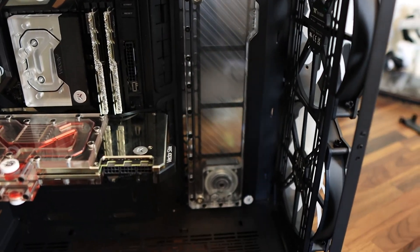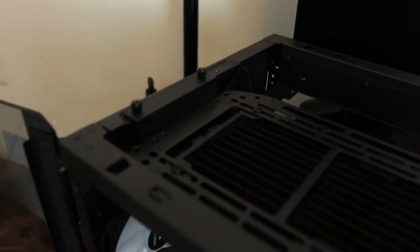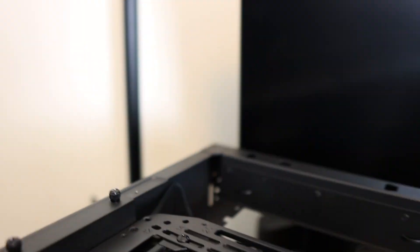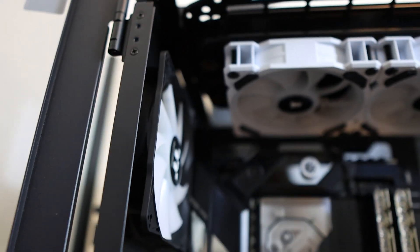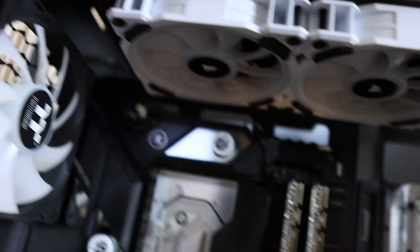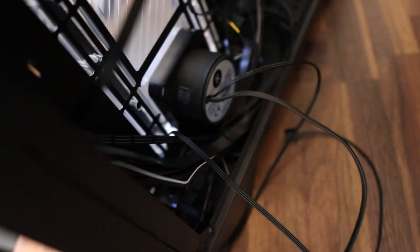After that the installation was very smooth. I then installed the rad with the fans on top of the case and had to move it a little closer to the front in order for the routes I had in mind to work. This was also one of the biggest reasons for creating this build — the old pump I had was just too loud and I couldn't control the flow rate. So here's my first tip: make sure to get an EK reservoir water pump combo and make sure it is D5. I will have the full list of parts in the description below.